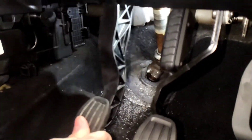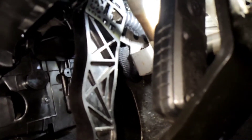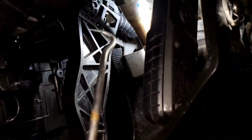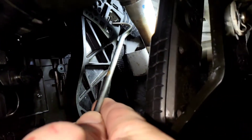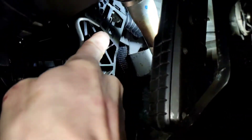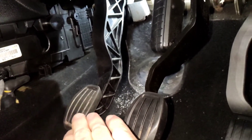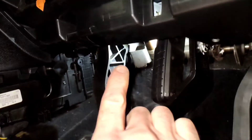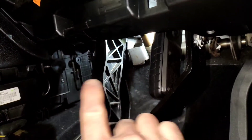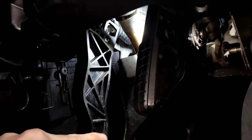We now have a good pedal. The only other small piece is where the new clip goes in - I had to grab it and push it and pull it back to get it to clip into this part here. The pedal was actually sitting up much higher because the new plastic clip part was moving backwards and forwards inside its housing. That's all cured now.